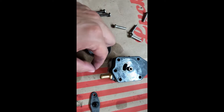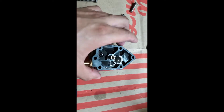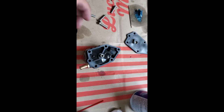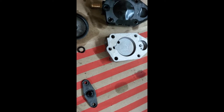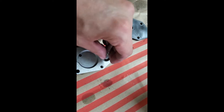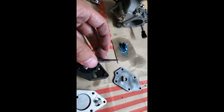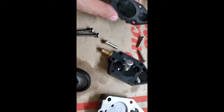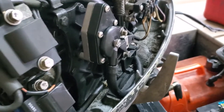I had to loosen this screw up, and then there's a little filter basket in there and also a little o-ring on here — don't lose that. These come apart nicely. Here's one membrane; looks like it's in pretty good shape. I popped it apart and there's a little spring and a little piston. Basically what happens is this sits in here just like so, and that little piston drives this membrane back and forth from one side to the other — that's how your fuel gets pumped. Same thing is going on down here. This is all driven by vacuum off the engine. I'm gonna take a close look and clean it all out, but I don't think that's my problem either.